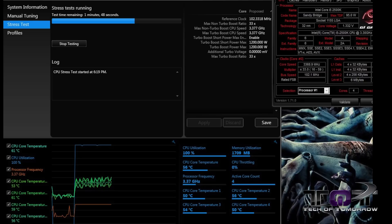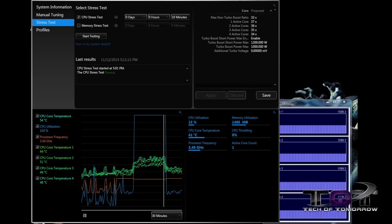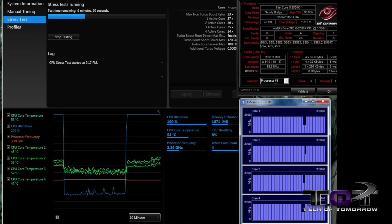Keep in mind that the ambient heat of your room is going to affect your cooling. If your room is 100 degrees, you can't expect your CPU to drop below that threshold — it's always going to be a little hotter than that. One thing about water cooling that's better than air cooling is that air cooling automatically takes all that heat and pushes it into your room, creating a hotter ambient temperature, whereas the ambient temperature is a lot harder to reach using a liquid cooler.